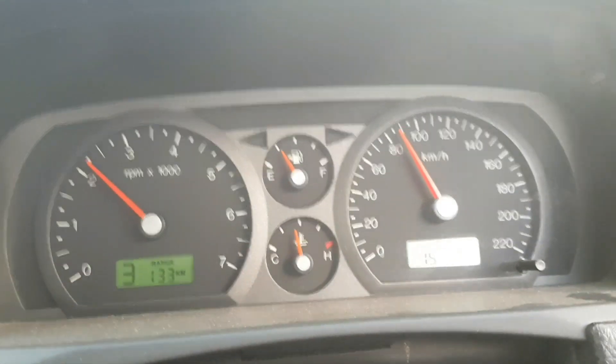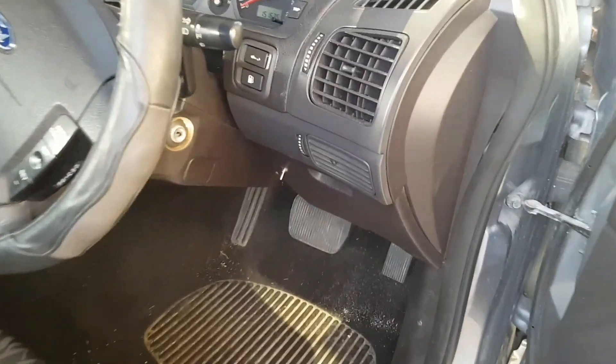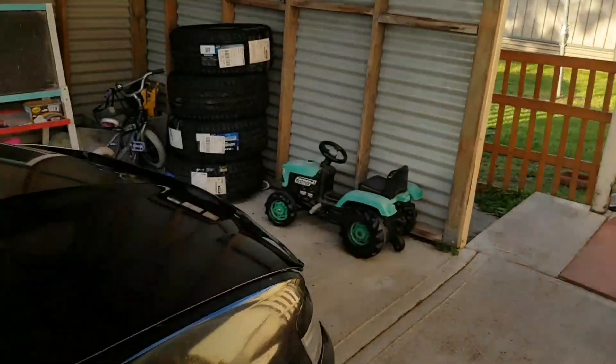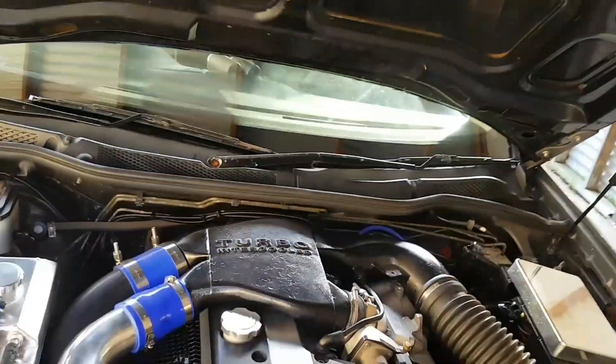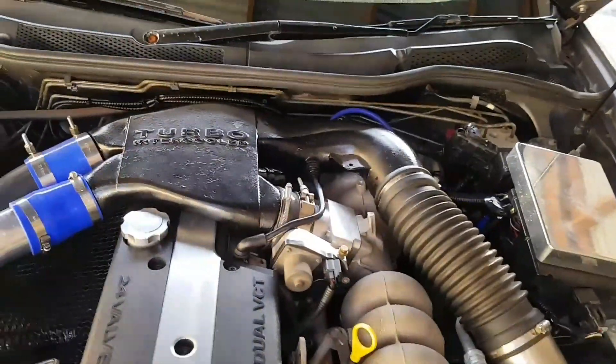Yes, it's definitely way better. Overall, definitely a worthwhile mod. There's your little switch. It's definitely good if you want to do a turbo conversion on a BA, or an NA four-speed BTR. It's just wired in underneath there to one of the clips, and pretty sure it just blocks off the third and fourth solenoid.